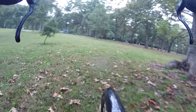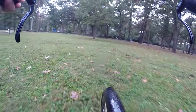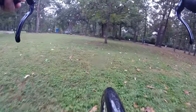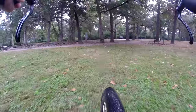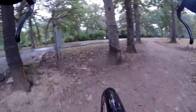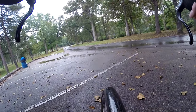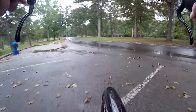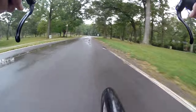On this beautiful day — it's nice and cloudy and wet everywhere. As I said, it rained and it might rain again today. On days like this, it's a good idea to think about bike maintenance. If you've got rim brakes like this bike has and you're riding in the wet, make sure that you clean your wheel rims, or wipe them down. Wipe down your brake pads a little bit after you ride in the wet.